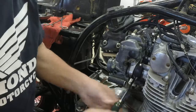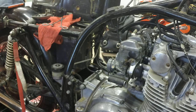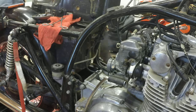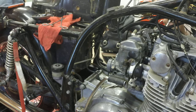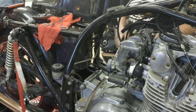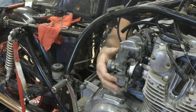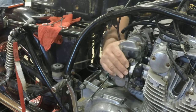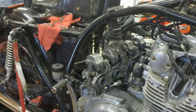I left out taking off the fuel tank and disconnecting the fuel line and the vacuum line — if you don't know how to do that, you probably shouldn't be doing this. You only have to loosen them up a few turns. We'll pull these carbs, clean them, rebuild them if they need parts — mostly I just clean them. That's it, just a few turns. Move the kickstarter out of the way on this one; later models didn't get the kick. Rock the carbs up and down, back and forth — that is how simple it is. They come right out.